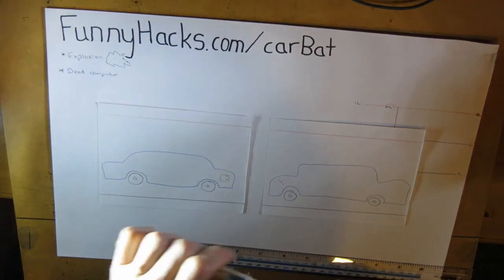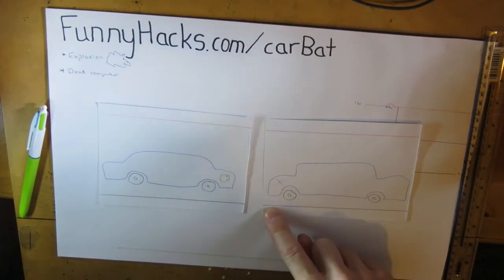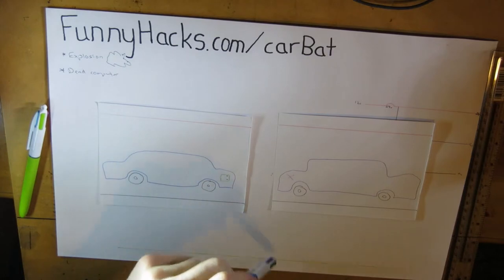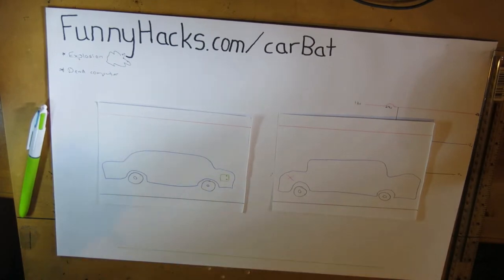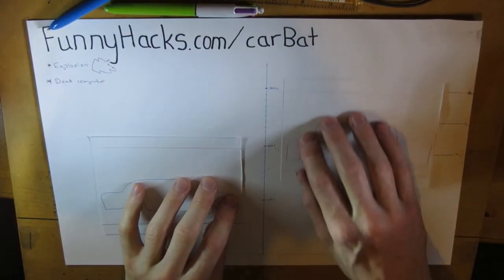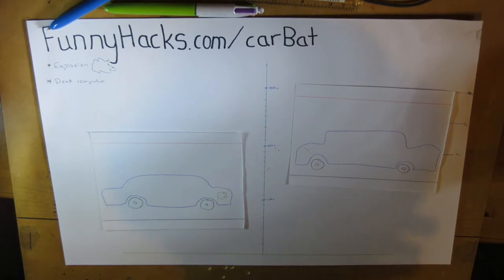What I mean by that is the ground comes into the picture as well. Between the zero volts here and the ground, there is a charge as well — that is static electricity. So when you open the car on a cold, dry day and you get a shock off the door handle, that is the charge between here and here happening, and that will be in the order of hundreds or thousands of volts. That is the sort of thing you need to be really careful of when handling electronic equipment. The cars won't necessarily be at the same charge relative to ground. This height I'm using here is just to represent how much charge each vehicle has from ground. This static electricity gets discharged when you make contact between two things that have a different charge.